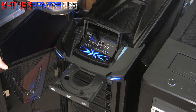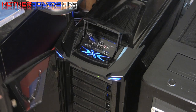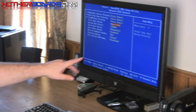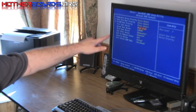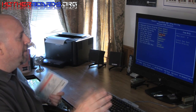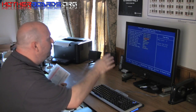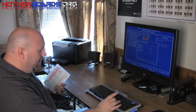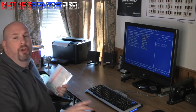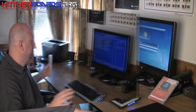The first thing you're going to need to do is take the Windows 7 CD and put it into your CD or DVD drive. Also take note: in the BIOS, you will need to set it so that it boots to your CD-ROM first. Most systems are set to boot to the hard disk first. On this EVGA SLI Classified motherboard, you go in and there's a boot device option — change it to boot from the CD-ROM first. Your system may be different, but make sure you do this, otherwise you'll probably skip the installation process.